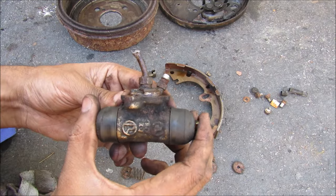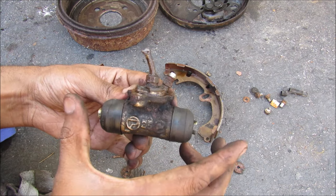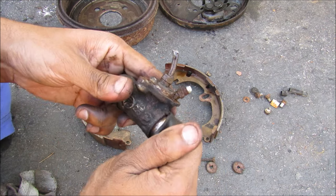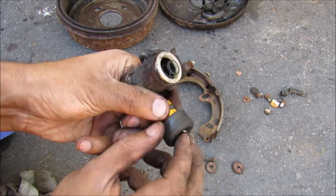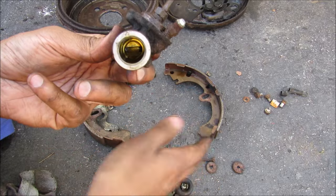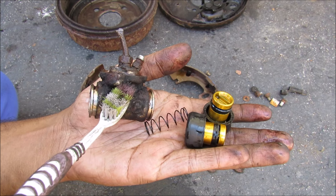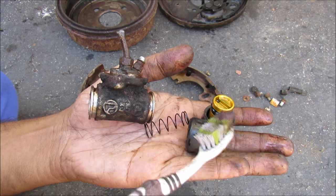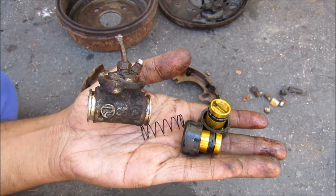The wheel cylinder is the heart of the drum brake. It's basically a piston with two ends that move out and press against the shoe. If I remove this boot, you can see the piston pops out along with it. There's a spring inside with some brake fluid. Basically, as pressurized fluid enters the housing it expands against the spring force, pushing both pistons outward against the shoes, which then rub against the drum.